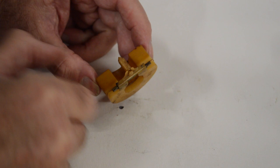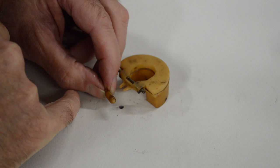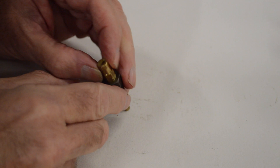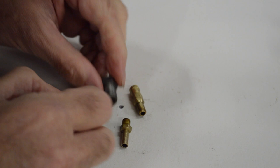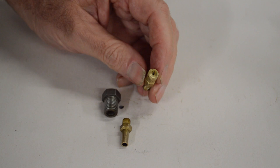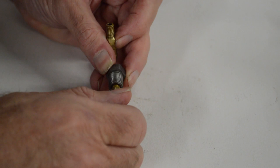The float I'll check in some liquid to make sure it does float. The pin's free which is good, although I'll have to clean it - it's a bit cruddy. The needle is the old all-plastic type which will be junked, so I'll be getting a new needle with the gasket set assuming everything else shows signs of promise. The jet stack looks okay; all the holes are clear. I'll check the jet sizes against what it says in the workshop manual and check the carb stamping, which should be marked for the model. I don't intend changing the jets - everything looks okay.